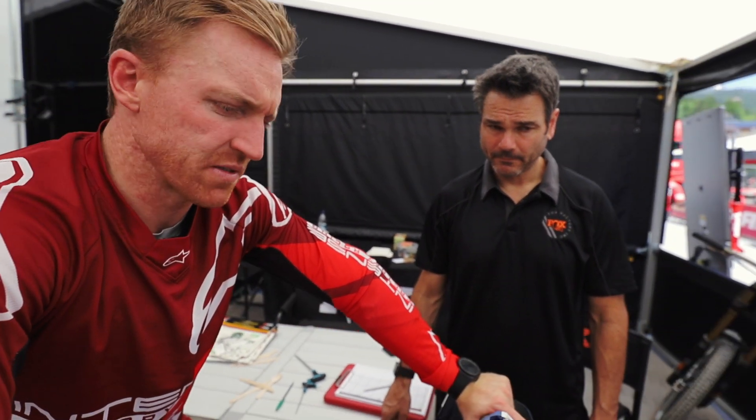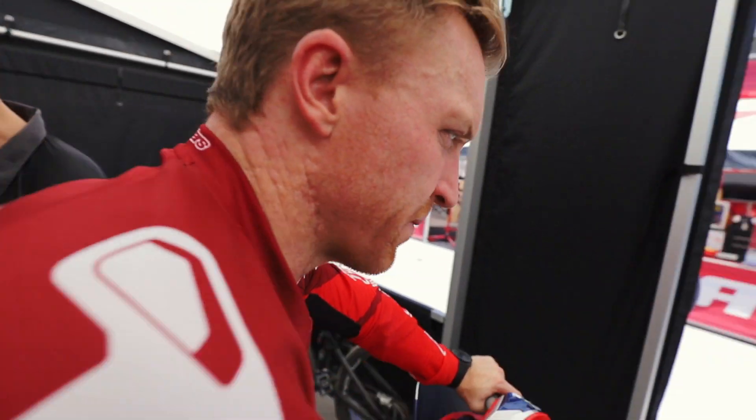Run that other shock over to John — we keep closing and it always feels a little soft. On the fork I just closed low one and high one. I feel like on those big step sections whenever I grab a brake it's kind of diving, getting all over the front. Firmed up the rear just a touch — I'll try a run like this before we switch shocks. Aaron's doing really good — up for his fifth run, about halfway through the practice day, starting to link things together. The only suspension changes have been adding a bit of compression to adjust for the hits and the heat.